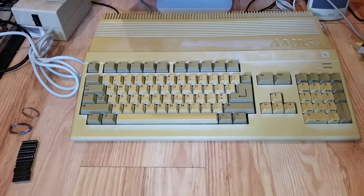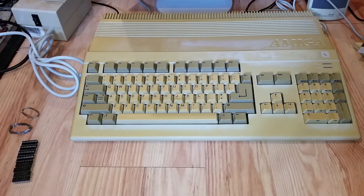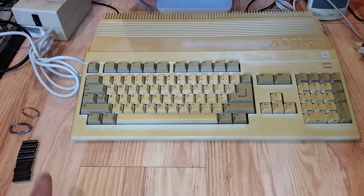I've got an old Amiga 500 which isn't in a brilliant state - it's got yellowing on the case. On eBay I bought some RAM chips, another 512K of RAM, because on the system board there's space to put chips directly on it. Most Amiga 500s had extra 512K added as an expansion card which fits in the bottom of the machine, and the advantage to that is you can switch it on and off for compatibility with some software.